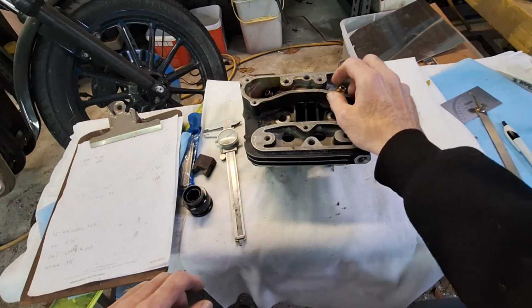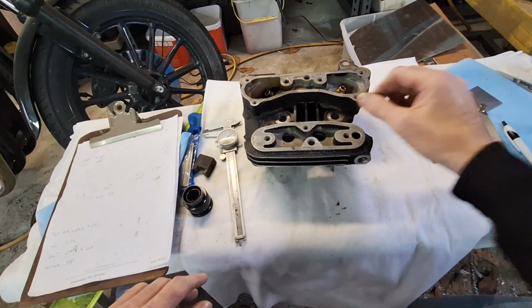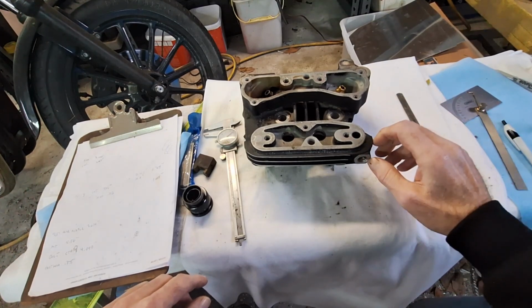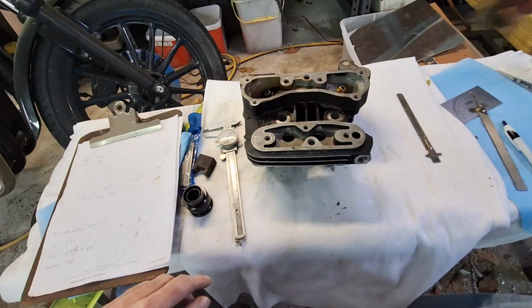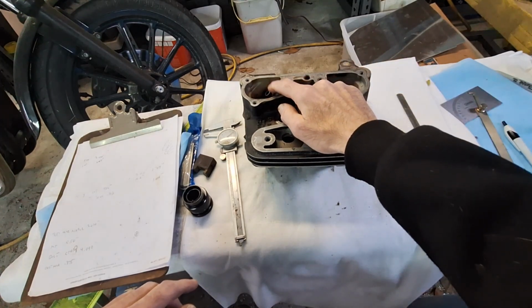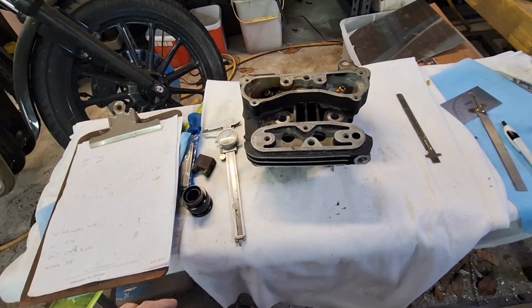So typically what happens, your valve guide wears, and usually it's just rings. Rings will smoke all the time, or especially if you're hammering on it, it'll start puffing smoke. With valves, especially if the exhaust valve is leaking a little bit and has a little play in there, especially something that doesn't use valve seals, on deceleration it creates more of a vacuum, so it sucks oil down past the guide into the exhaust port. Intake too.